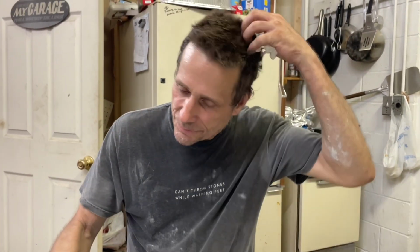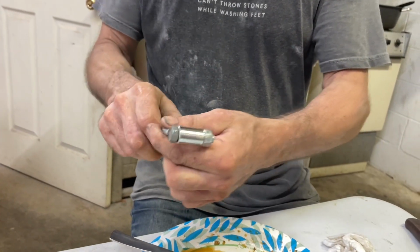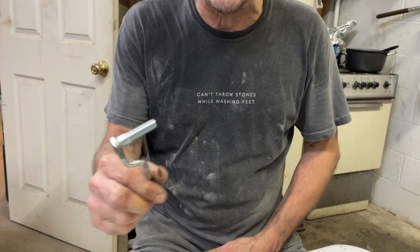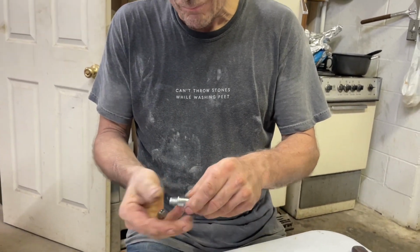On our rod ends, we've got, well, how many did we count? 18 or 20? So you get rod ends and clevises, you put a little anti-seize on there, and we got 3 on each link, which is 12, and then the radius rod, and then you got your steering rods and drag links. It's a 5/8 thread, so that's a 5/8 sleeve. You put this in your drill, and you just spin them in. And then the little clevis ones are 3/8, so that's the 3/8 part of it. There you go. Man, pretty clever. We're gonna have to see that in action here.